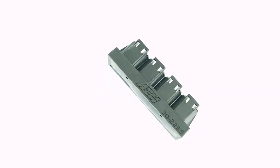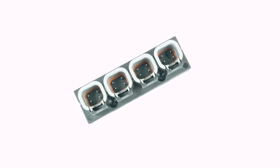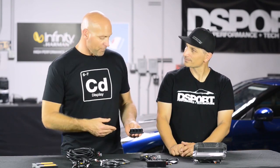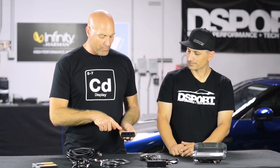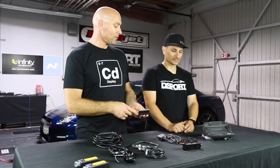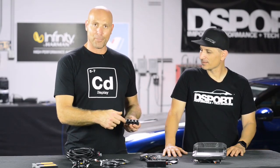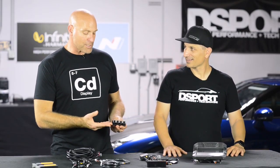Our engineers are always looking for ways to make things a little bit easier. It doesn't take long to figure out, as you start making these Y-type daisy chains on your harness, that you're going to have a lot of stuff hanging off of other stuff. Our guys came up with this — it's a really nifty little way to tidy up all of your CAN bus connections. It uses your standard four-pin style DTM connector, like a Deutsch or an Amphenol connector. As long as you have a terminating end on each end of the bus, you can add three sets of inputs going to your digital dash display — actually up to six by daisy chaining two of these together, using a jumper between the two modules. We just released this and they're flying off the shelf — people love it. It really makes your installation simple.